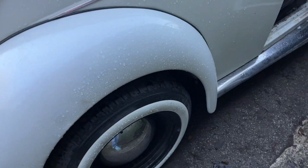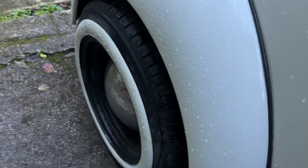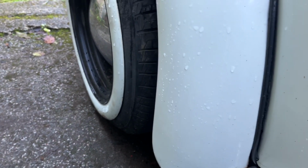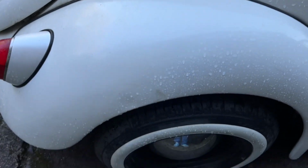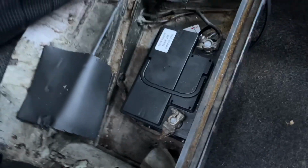Let's get back to the 72. Don't know if you heard it last time, very clear, but here's the clicking coming from the starter motor. Now I've bench tested the one I put on, all good. So I reckon it's a ground, a bad earth. But looking at that cable, clean that one up first. If that's not it, I'll check the gearbox.